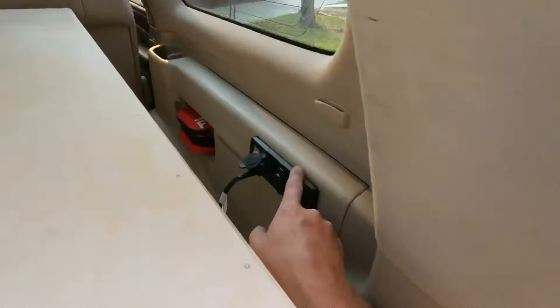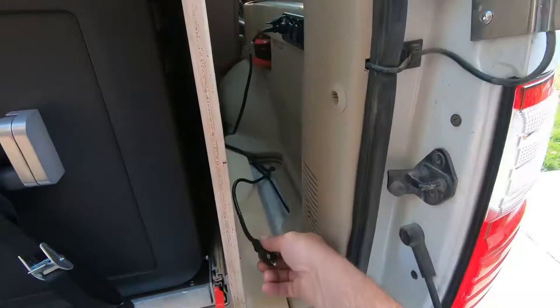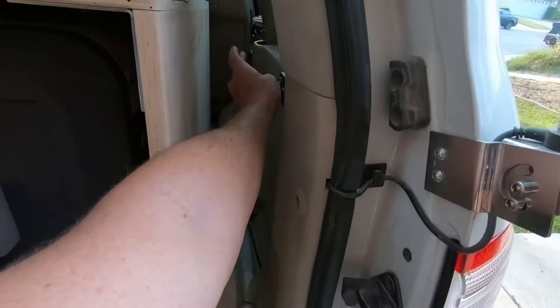Really excited that the accessory panel that you saw in one of my other videos is working. Still have good access in here, still can get to my first aid kit, and of course we're plugged in — I have the AC cord now. For those that don't know, with the newer Dometic series, you can't run the AC and DC at the same time. So basically what I'll do is switch this off, plug this in, and then that's going to allow the fridge to run efficiently.